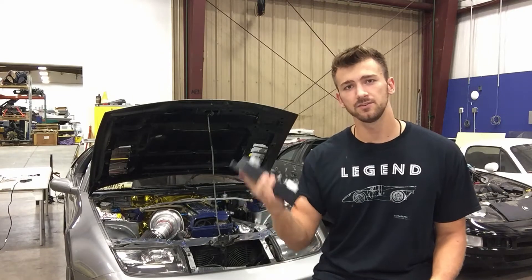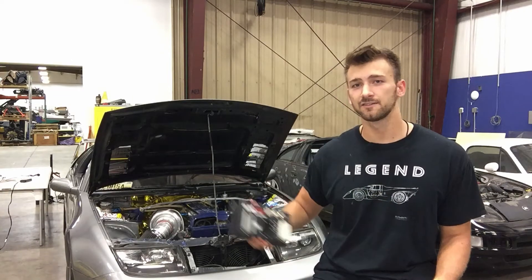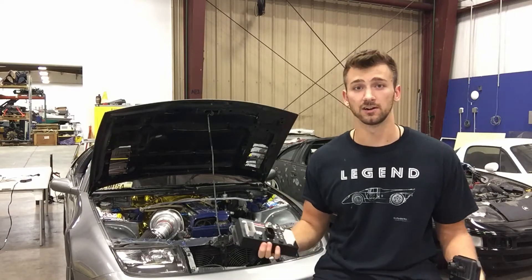Without giving any bias, I'm going to put the link in the description for this ECU and you can go through the specs yourself and figure out why I'm choosing to go this route aside from my affiliation with working here. So with all that said, let me give you the details on my plan of attack for taking on this entire ECU swap, and we'll start with the pinout. The pinout is going to tell me what pin on the current ECU translates over to what pin on the MS-3 Pro Ultimate. Every pin has a certain functionality and you want to make sure that functionality is kept in the new system. My Excel doc will tell me what wire goes to what pin on the new ECU — that would be step one.